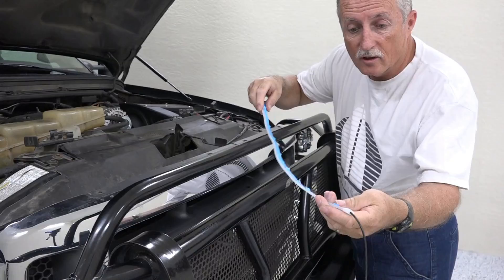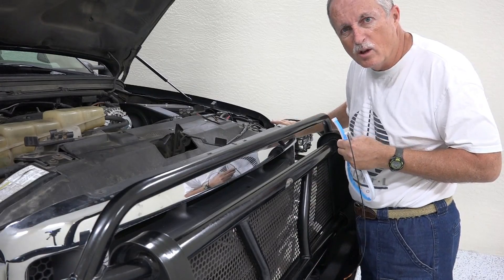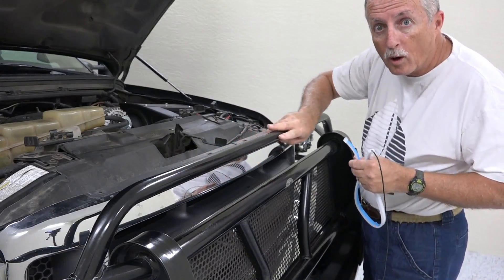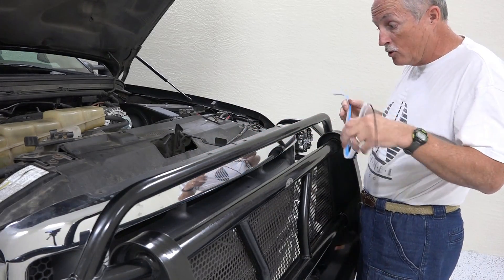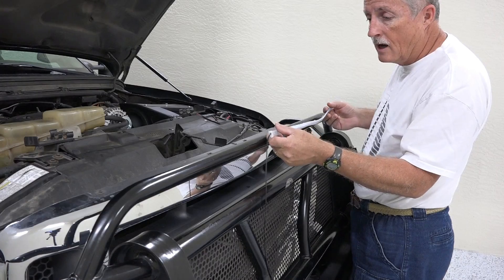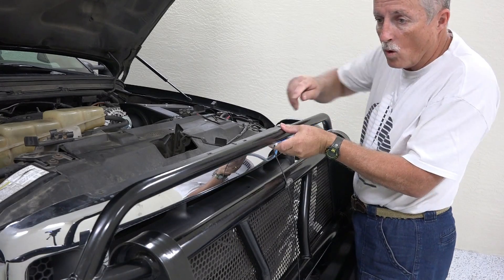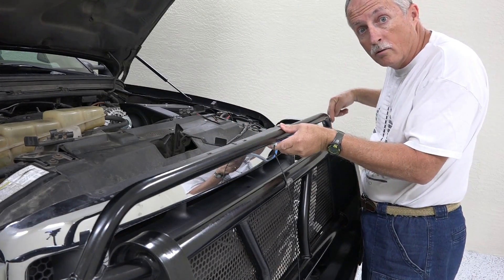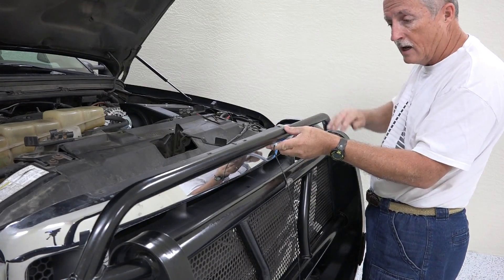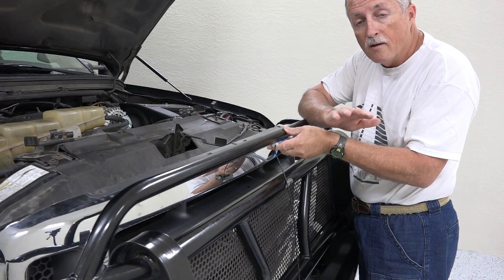My plans for installation of these sweeping LED lights — I looked to put them around the headlights, but it didn't really fit well there, plus it's still too low. So I decided this top roll bar of my roll cage or brush guard is where I want to install these. I don't want to put them on top, so I'm going to put them underneath like this. It will make one continuous white light for the daytime running lights, and the sweeping LED for the turn signal will go all the way across the front. It's up higher to get around the scooter, so it'll be visible from everywhere.